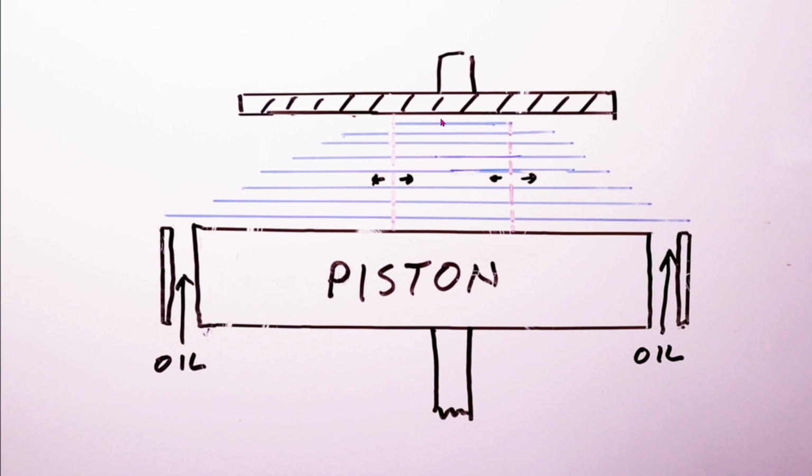So when you tighten the nut down, this doesn't move. These shims all move. You can see this can move and this can move and so on, but this can't move. And also, if you draw a line directly down from the outside of that clamping shim, none of these shims move inside of this area. They all start bending right here. And as we know about leverage, the more leverage you have, the easier it is to move anything. So this port pushes here, and it has a certain amount of leverage on that shim.